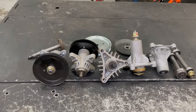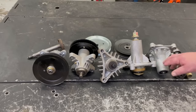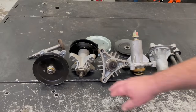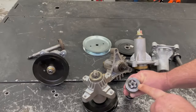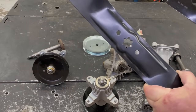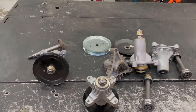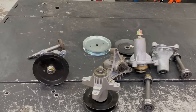Here's just some of the different styles of blade spindles. These are AYPs, like Sears, Husqvarna, John Deere, all them. And these here are MTDs. They both have stars on them. The AYPs have more of a rounded star and the MTDs are more pointed. Here's an MTD blade and here's an AYP. A lot of the original equipment didn't have Zerks on them.